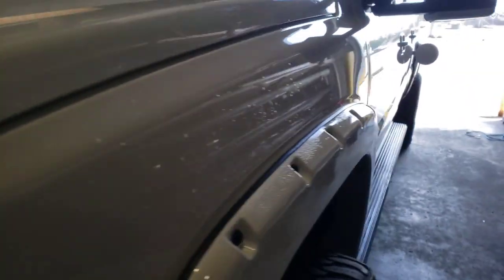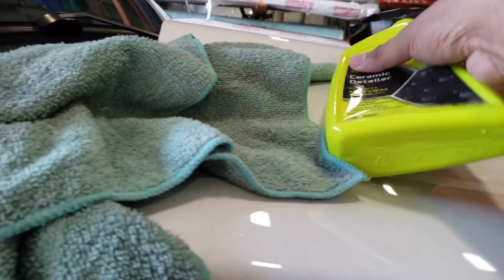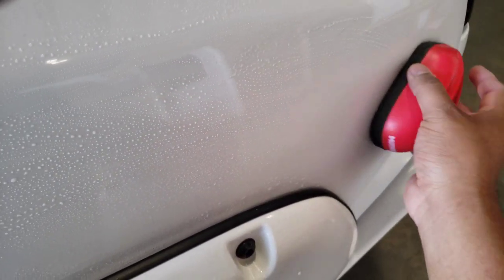There are some things I missed the first time since it was my first job, so I'll get those fixed. For the clay bar step, all you do is pick a panel, spray it down a little bit, and glide the clay bar over it. It's already pretty smooth. Go back a couple times — let it glide — and then get your rag and wipe it off. Even just doing that, it's super smooth.